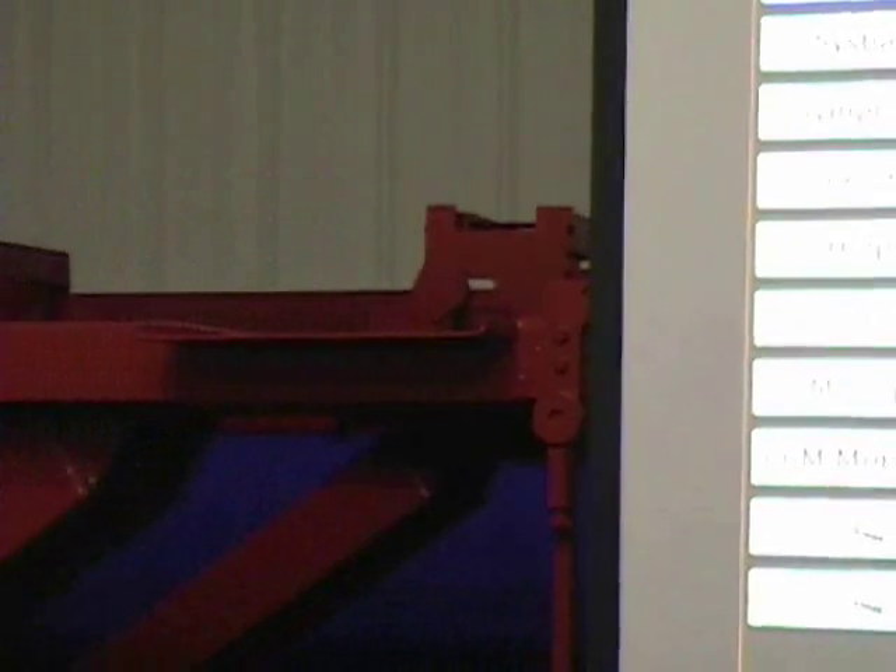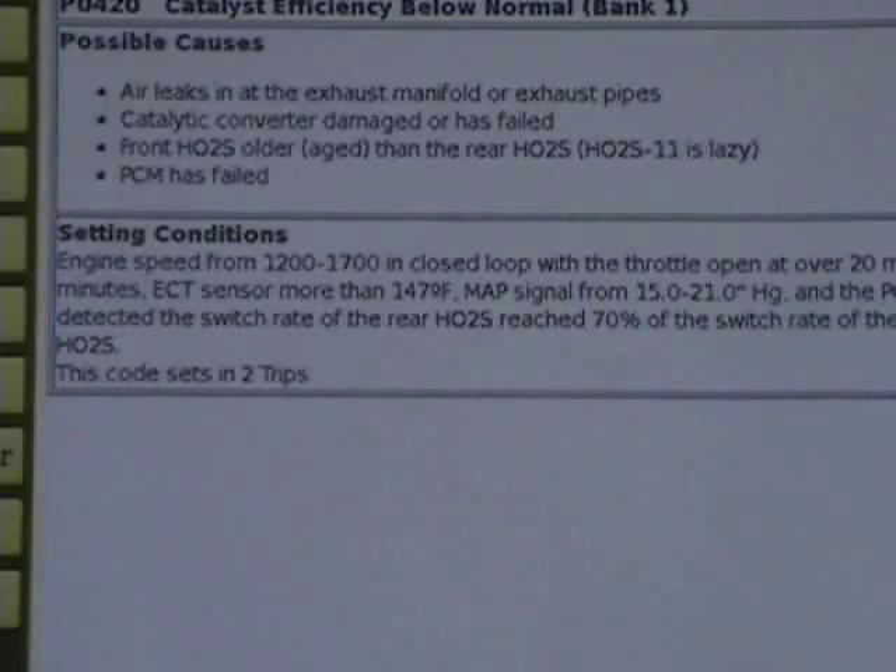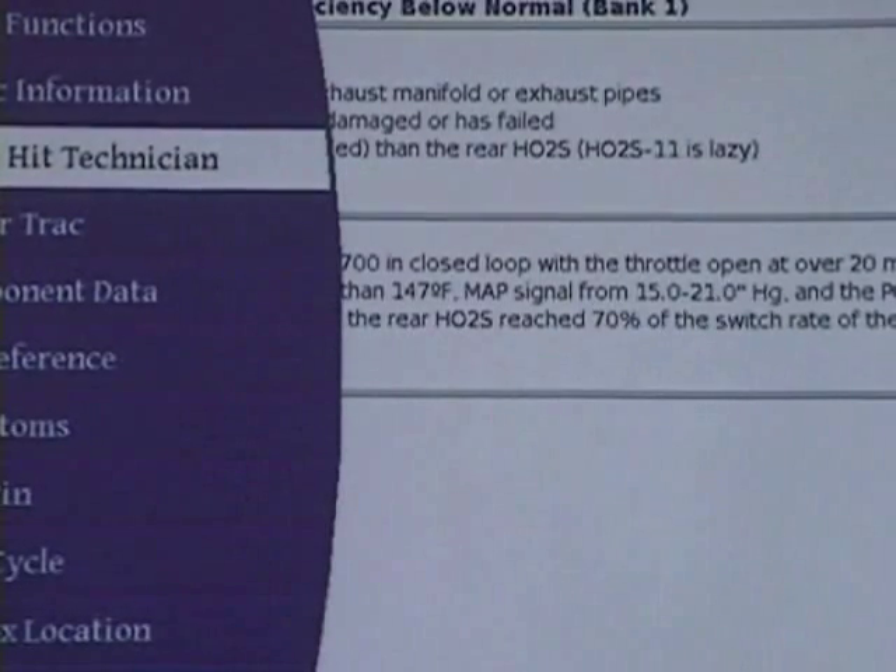Let's ask some questions. Are TIDs and CIDs the same from OEM to OEM like DTCs, or can they be different? They are different - they're all over the place. They can be very different. They're super different; not only different from manufacturer to manufacturer, but same manufacturer, different car. Same manufacturer, maybe the same car, different model year or whatever. Or sometimes options. Make sure you look it up.